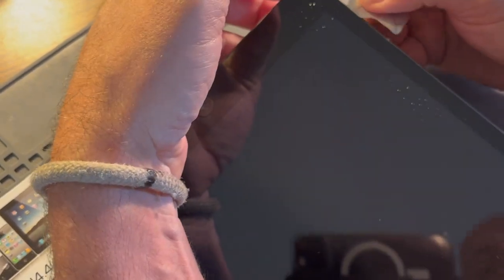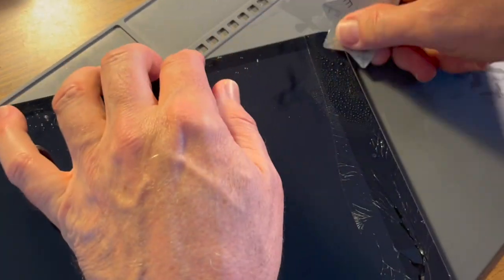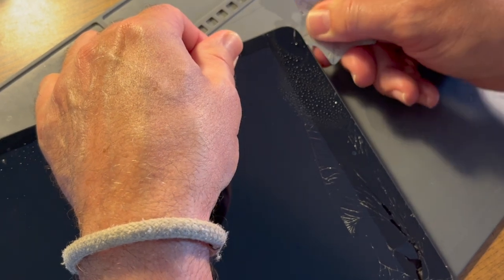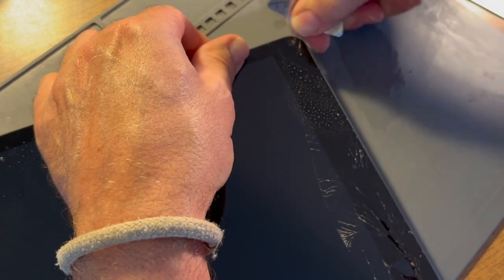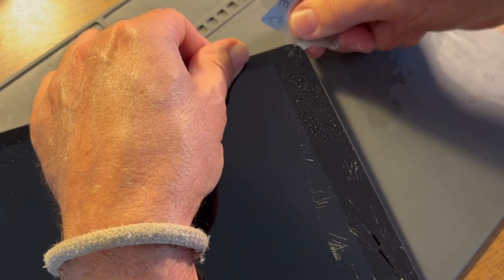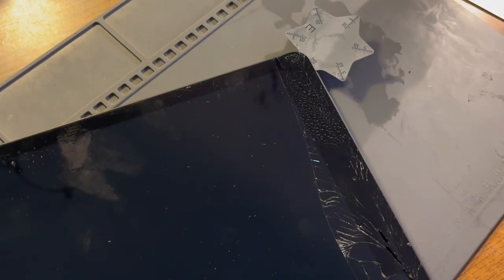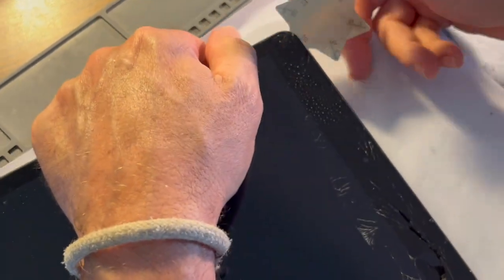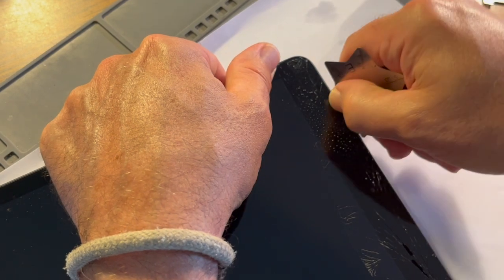I'm going to work this side now. When we get to this corner, we're into some more fragmented stuff, but I'm going to use the same process. I'm going to get plenty of alcohol on this tool. In the corners, there is a thicker amount of adhesive. I'm just slowly letting that alcohol seep into the cracks there nicely. On these corners, take your time, especially when you have all these fragments. This tool — I can't imagine trying to do this repair without these types of pry tools. It can be done, but these pry tools make all the difference in the world for getting these little fragments off the adhesive.